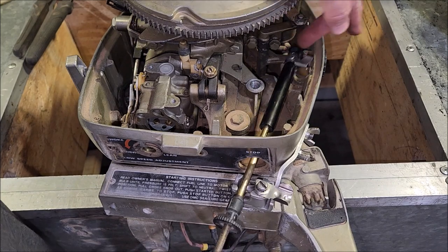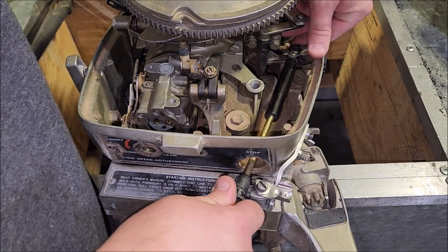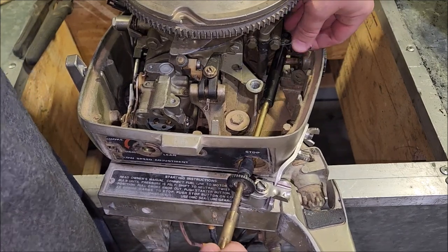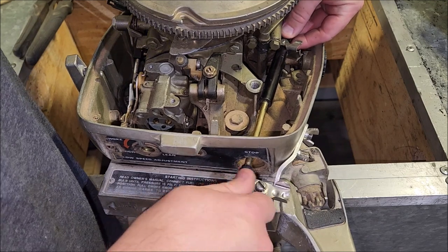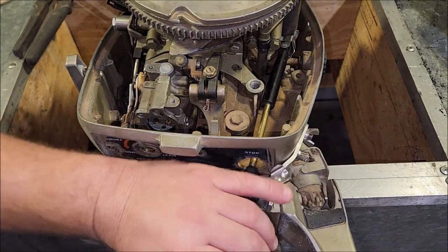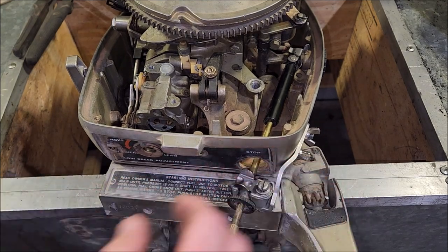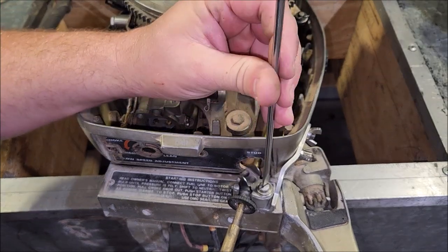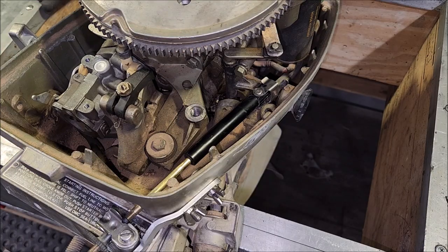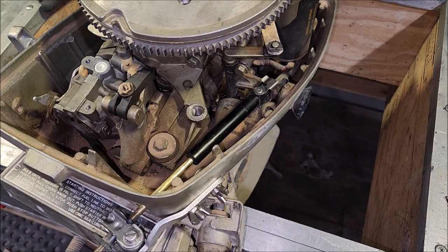The back of our little clip and that little hole in our cable — I'm going to slide it right over that little boss right there. Clipping this on is sadly really the hardest part. Alright, throttle is connected. And that's how it installs. When you use your throttle on your remote shifter it advances the throttle, and throttle back it goes back in. Easy.